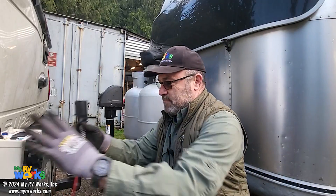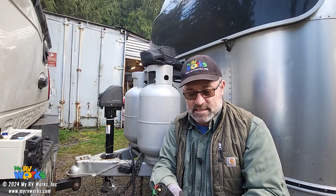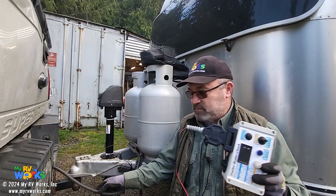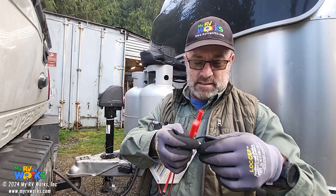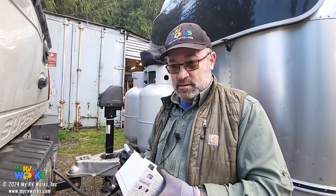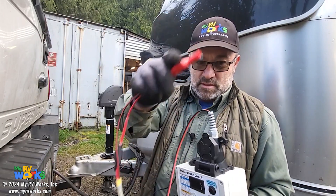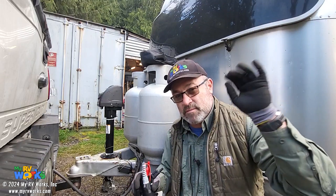Another tool I have here is still being designed — it's just a seven-way but two-conductor. I took a test lead set that we make with banana connectors on the end, and you plug that in. When I make it properly it'll be a single banana connector, and then you take whatever fitting you want — we have quite a few in our test lead set, like big alligator clamps. With your alligator clips on the end, you can skin back and connect to your individual brake pad. Another connector we have for this is a piercing probe.